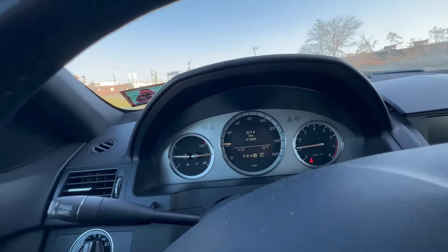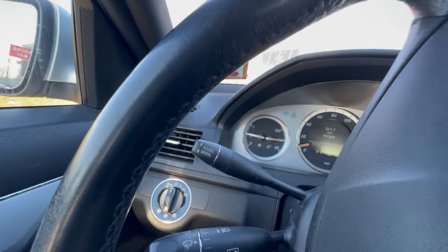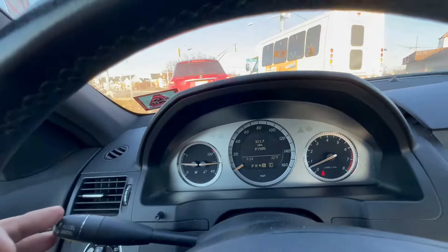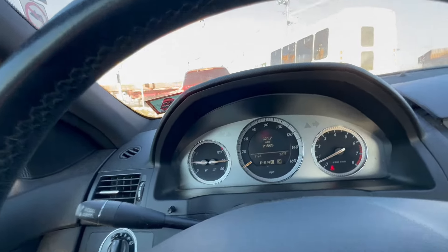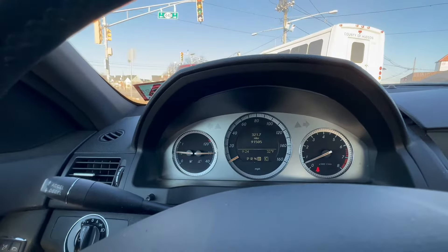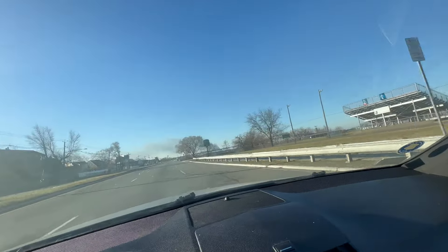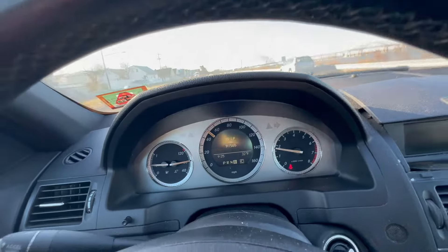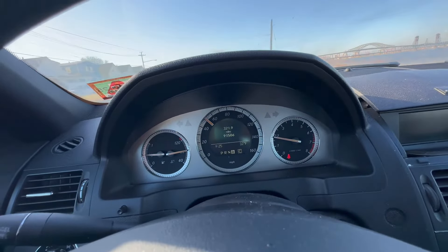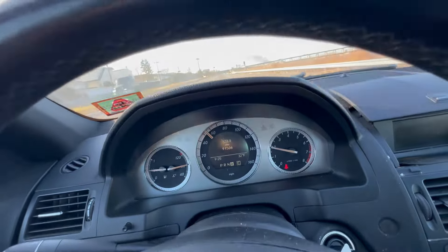We're in the Society Hill area of Jersey City if you're local. We're making a U-turn here and the temperature should rise a bit — if there's an issue it might rise a lot. Standing at a red light without wind force will cause the temp to go up. But that red light wasn't too long — we're back on the highway. You can see that fire still burning in Elizabeth. Temperature stood at 80 degrees, so we do have a thermostat problem — it's not holding temperature to keep the car warm.